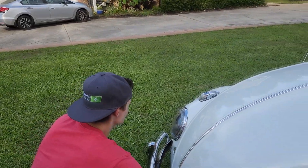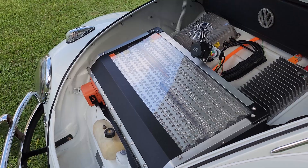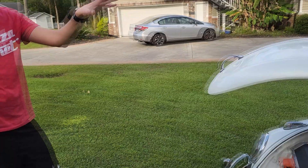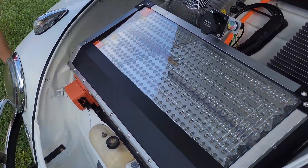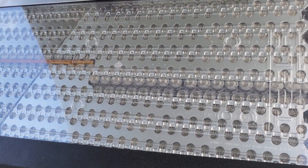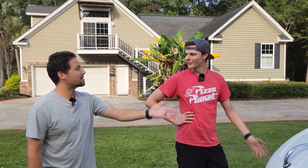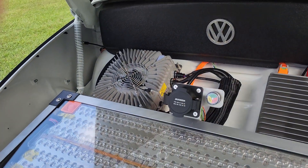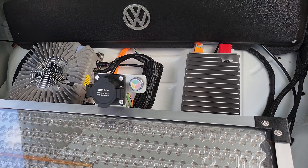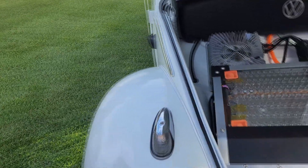Let's dive under the hood and take a look at some of the modules. We use Tesla Model S/X 18650 battery modules - just five of them. There are two in this battery box up here and three in the battery box behind the rear seat. You can see the one up front - got the plexiglass so you can see the module underneath. Get a closeup to see all the individual cells there inside the module. We also have the J1772 here as well. In case anybody's wondering why we didn't put it in the gas door - the '63 doesn't have a gas door; you actually filled up underneath the hood. So we're putting it exactly where it was previously. We have the Elcon DC-to-DC on the right-hand side - it takes the high voltage, steps it down to 12 volts, and powers the low voltage system. It's still a 12-volt car. And on the left-hand side we have a Thunderstruck 2500 charger - that's the onboard car charger.